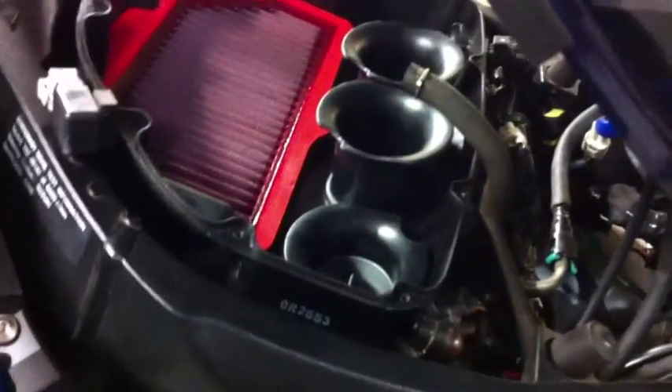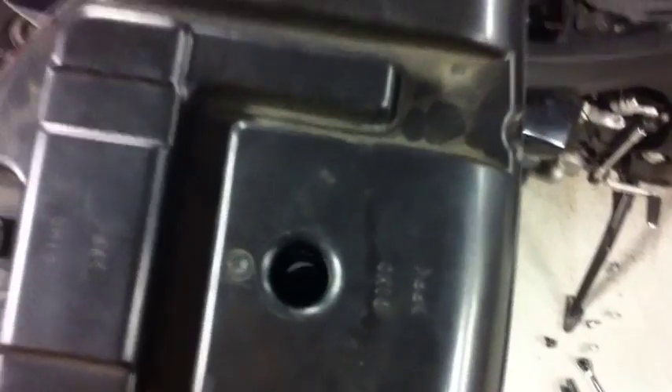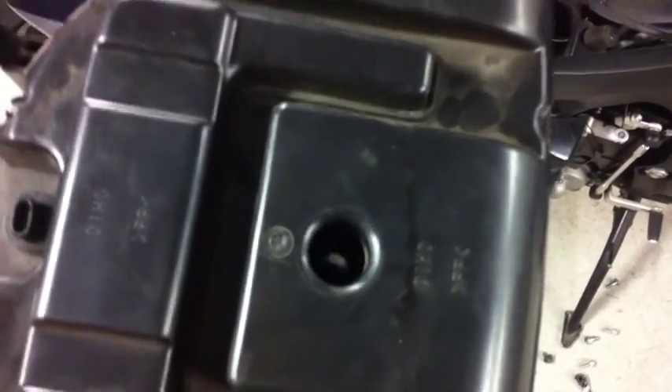Okay, this is what you do to get to your regulator and stator wiring under here. First you have to take your side cowlings off, take your seat off with two bolts here and on the other side, take a bolt off here with an Allen key, pop the tank, get yourself a nice strut to support the tank while you work, take the air box cover off. There's one pipe here and also a screw down in there which is sometimes hard to find — it's in the middle and screws into that hole there.